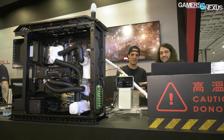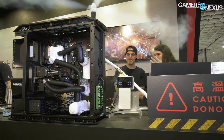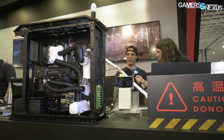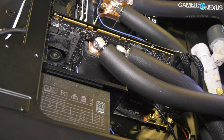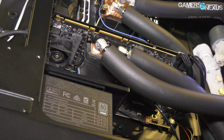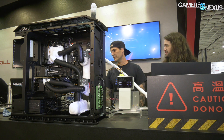Other components on the system — we're still running through Time Spy. Looks like it's stable. We have the X299 Dark for the motherboard, I can see that on the back plate. I'm assuming all EVGA parts. Power supply is the 1600 T2 — a great PSU for the 7980XE. And we've got the Titan V and G.Skill Trident Z DDR4 memory. The Titan V is modded — Tin put some mods on it. One of the easier mods is just two fans on the VRM components, plus a custom block from Roboclocker on the GPU and another one on the CPU.